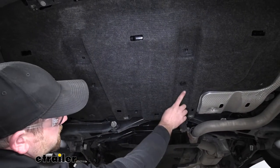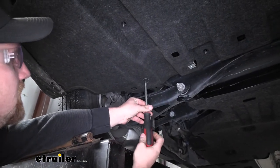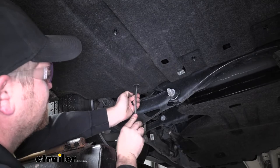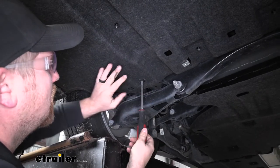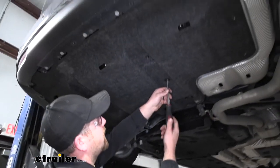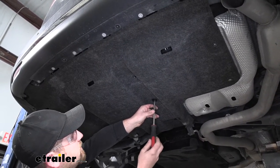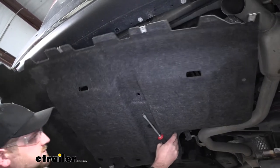We're going to have two more fasteners — one here and one here. Take a large screwdriver, put it inside, and loosen them up. Sometimes these will get hung up, so you might need to grab the panel and put some downward pressure on it while you're turning to help free them up. These aren't going to come off the panel — you'll just be able to feel whenever it becomes disconnected. These are the last two things holding the panel up, so whenever we get those off the panel is going to come down. Just work it out and set it to the side.